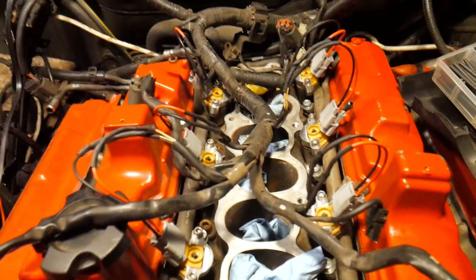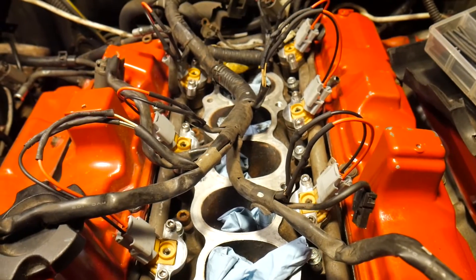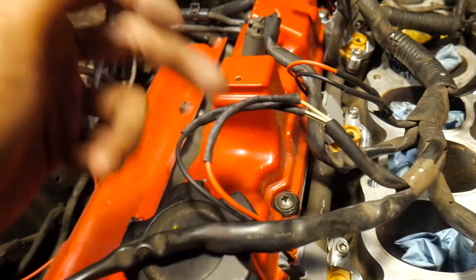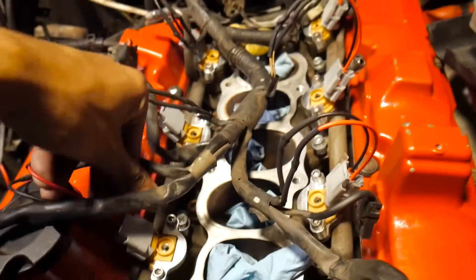This is what it looks like after it's all done. I've heat-shrunk them and checked all the injectors — they should be at 11 ohms for these particular injectors. I checked in between the points of connection after I soldered them and they are 11 ohms, so it should work out fine. They also click into place with ease.